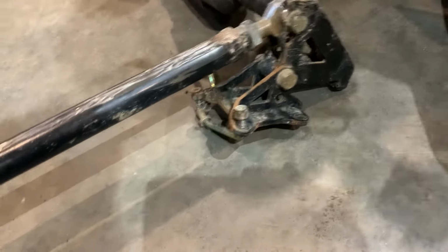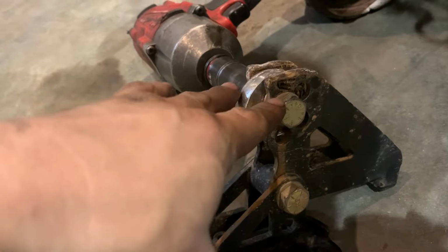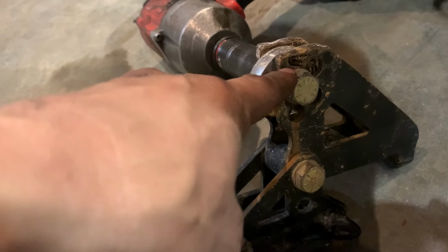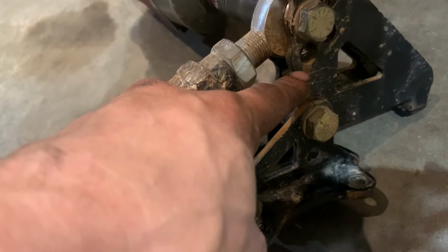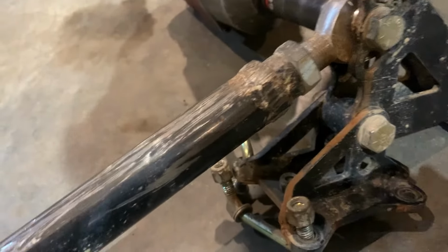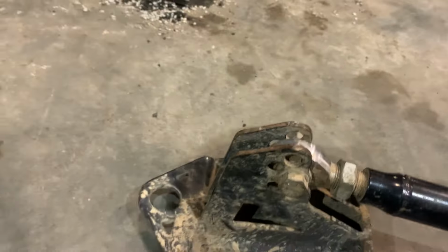Today I put these assassin bars on there, but my truck setup is just so low. These assassin bars have five holes of adjustment here, and I've always had it in the middle hole with excess bracket hanging out. I'm going to move it to the highest mounted hole, away from the ground as far as it can be, and cut off the rest of that on both ends.